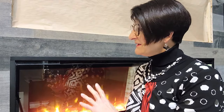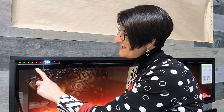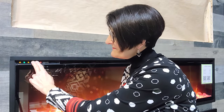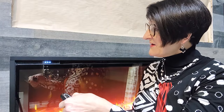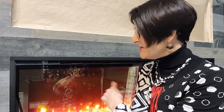If I want to lock out the heater — useful for people with little kids who touch everything, or in a public area like a lobby where people might inadvertently turn on the heater in July — I can do a heat lockout. On the touchpad, take the heat button (the wiggly lines) and the temperature down button and hold them at the same time. You'll get dotted lines indicating heat lockout. Now if I try to engage the heater it will tell me the heater is locked out.